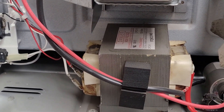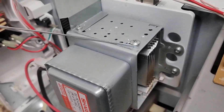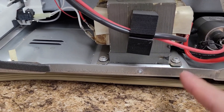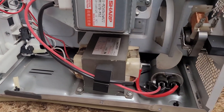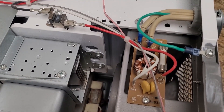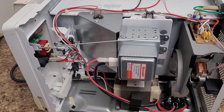Unfortunately, I don't think I'm going to see anything visually obvious. I think something shorted out internally is going to be my prediction. There's no external charring of any kind — that's just a weld mark from when they were welding the transformer together. Somewhat uneventful. I think while I have this open I will check the fuse, but the sound it made was not a fuse sound. It was definitely a high voltage sound because of the frequency of it. But I'm going to grab a multimeter and see if the fuse is any good.